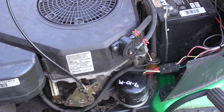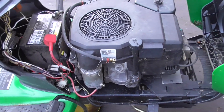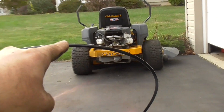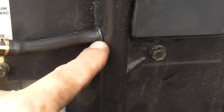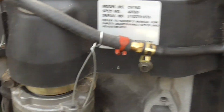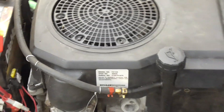This is mainly what I wanted to show you guys. You can see I have a Briggs and Stratton fuel pump on there — I took that off the Briggs twin that was on it. What I did is I drilled a hole the same size that was going into the valve cover on the Briggs and Stratton engine. I took that tube and put it in here — there's kind of an O-ring, then a spacer, and another O-ring on this tube — so it is a good seal. I wasn't sure how well that would work, and then I put a union in here and extended the vacuum line all the way over to the fuel pump.